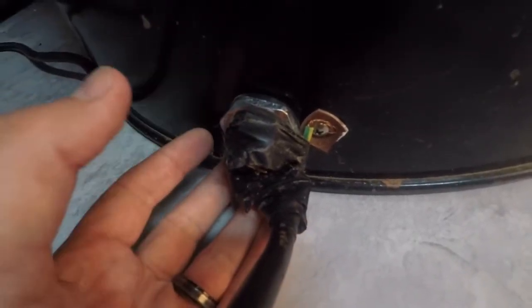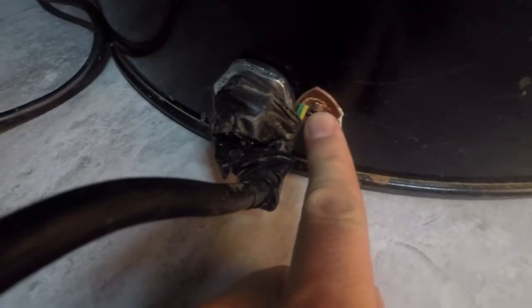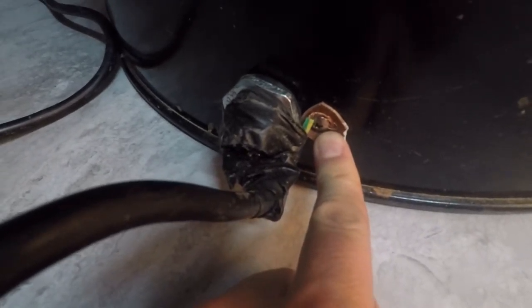Looking at the element here — it's just a water heater element sticking out. I put some tape on there, not the best thing in the world. I honestly did that in case my kids come into contact with it. I'm going to replace that with something better. Eric Myers mentioned that the hot pots are really fragile and break off easily. Always make sure that you ground these because you do not want to electrocute yourself by accident.